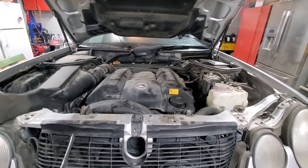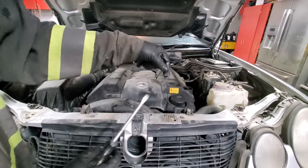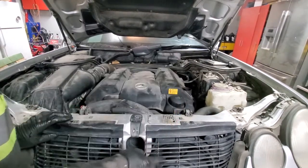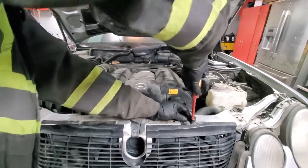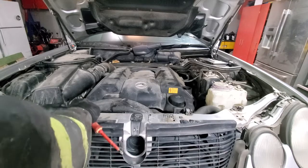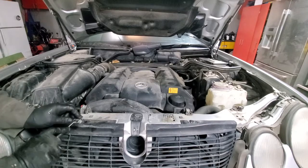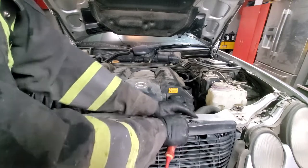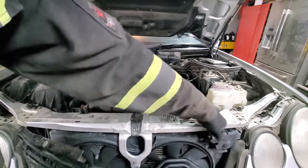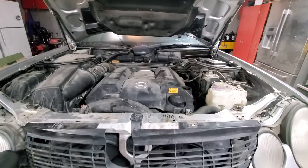So while the fluid is draining, we will remove those two clips on both sides. So this tongue pointing forward, and next we will remove this grill, so we'll turn this 90 degrees and it should come up, same this way. This piece just fell off. There is a little hose clamp holding it on the other side.